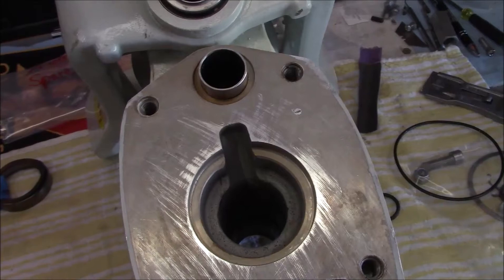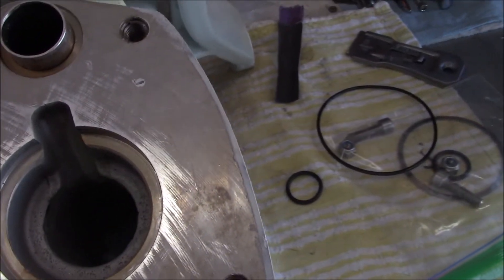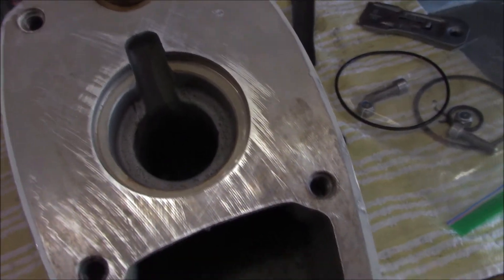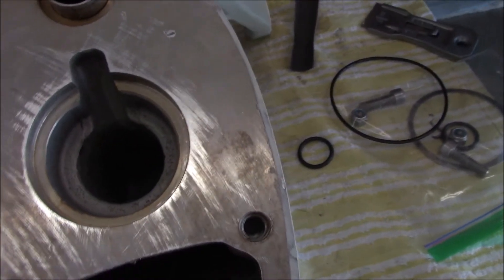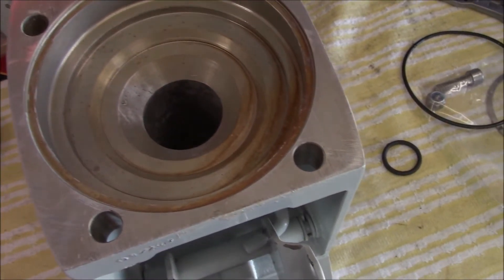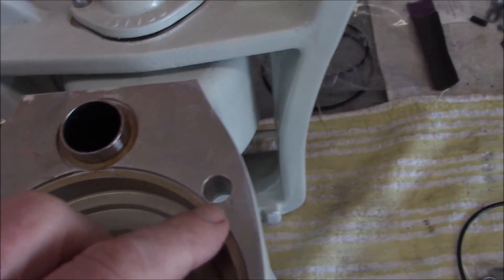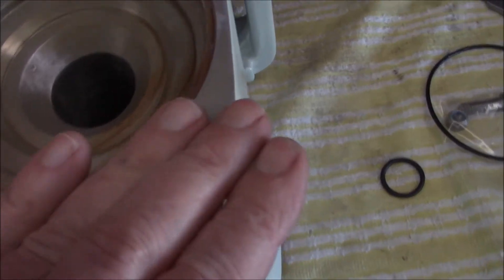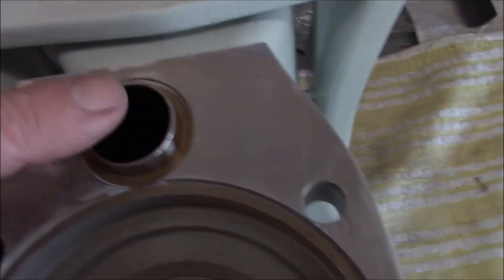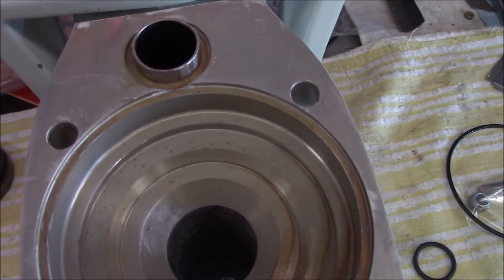This side is cleaned up and ready to go. I removed all the factory sealer and did a little draw filing to take care of a small dent and a couple of high areas. We cleaned off all the factory sealer using a razor blade and some acetone, and we deburred the little nicks. Everything is nice and flat — be very careful not to remove any material. We also swabbed out the oil return tube; there was a little bit of debris in there, and we'll blow everything out with air before assembly.